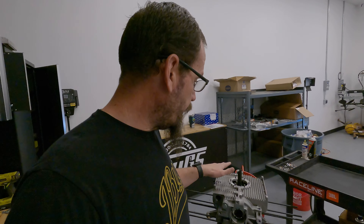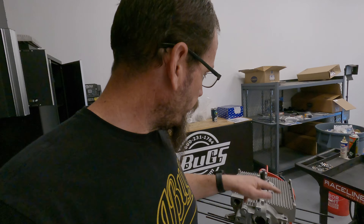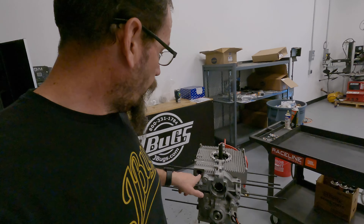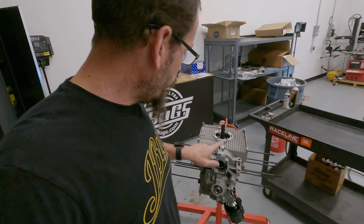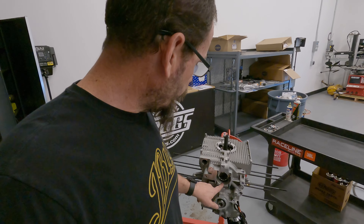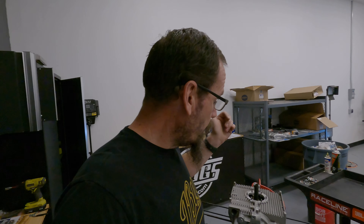The deep sump is a lot of weight and extra assembly hanging off the bottom, so I'm not going to install that until near the end. While the engine's upside down, I'll put in our pressure relief valves and pistons, our oil pump, and oil filler block-off. I'm going to be running a temp sender and go ahead and get our oil pump installed. I'm time-lapsing all of this — that's a good combination of filming and still being able to get this done hopefully in time.